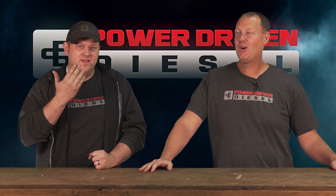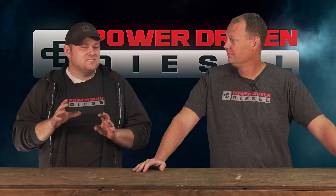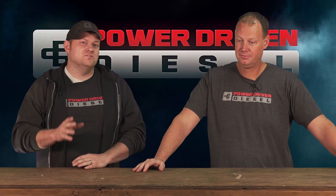For those calling them twin turbos or compounds — whatever you call them — there are two reasons I like compound turbos. One: 12-valves like pressure ratio; they just seem to run better with a lot of boost. The other reason we wanted it on this truck is that two turbos really quiet the exhaust note, making the truck a lot more pleasurable to drive. If you ever drive a big single and tow with it they drone and are nasty. Compounds are way better for something you're going to put miles on — they harness waste energy, both heat and sound.